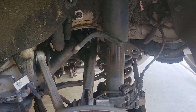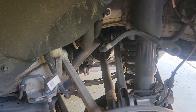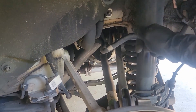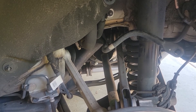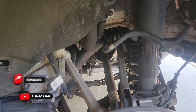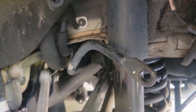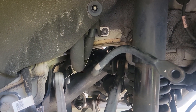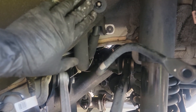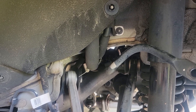After removing the other end link, it seems the bushing is already under tension — after I removed it, it raised up about another five to six inches. Any time I push down on it the bushing doesn't move, so it's encased and sealed, meaning I have to work around it. I went ahead and placed a zip tie in there to try to get a little more room. If that doesn't work, I'll take the lines off and use a bungee cord to pull them further to the side for more clearance.